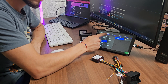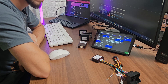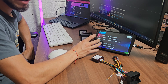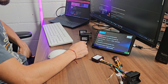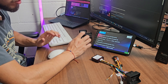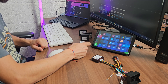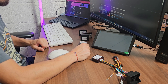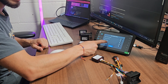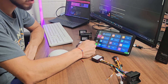Let's come back — you have Golf Mark 6. Choose Golf Mark 6 and press OK. Just wait for it. After you see this page, the CAN bus is already set up. Now you can try your steering wheel buttons to see if they work. If they work, in most cases you are ready and don't have to do anything else. Sometimes when you open the front and back doors it might show the wrong door. To change this, go to main menu, then My Car, then Settings, then Door/Window Settings. For example, if you want to swap the front doors, press F-Door Exchange, then confirm.